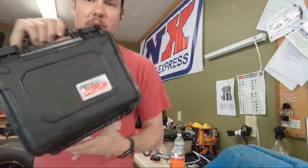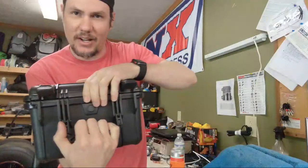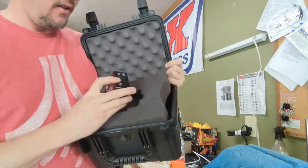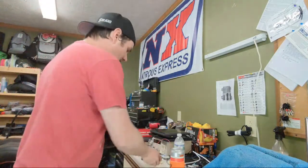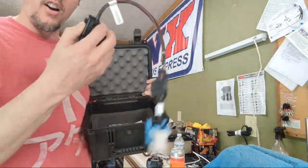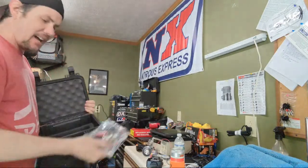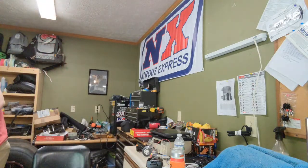I've got the E90/E99 harness and all that fun jazz. Whenever you buy the starter kit it comes with a nice case. This is the main brain module - it's got power and ignition modes. You've got a switch where you can go ignition or ignition with a CAN bus resistor. We shouldn't need a resistor because we're talking to an ECM. Underneath we have our E90 harness, which plugs into the adapter harness that goes into the BenchForce unit, and then we've got power cables with alligator clips to go to a battery, but we're just going to hook this into our power supply.